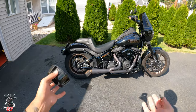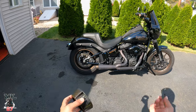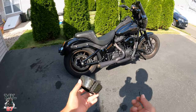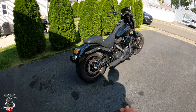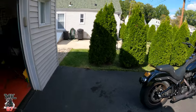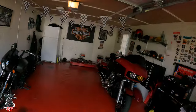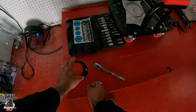It's like a thousand dollar exhaust and something so little like this is happening. Why is that even a thing? So I'm gonna find the screws, put them back in, hopefully add some Loctite, and we won't have any issues after that. If you are in the market to get this exhaust, that's something that could be happening, so just keep that in mind.